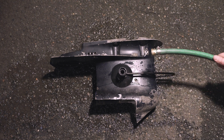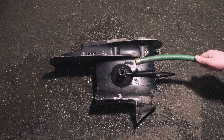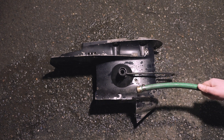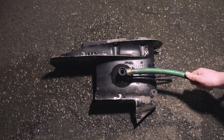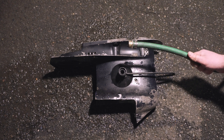What I've heard — I've not actually experienced this myself — but if you turn on the hose with too much pressure, what can happen is the water can push around and make it difficult for the engine to actually suck up the water because it's not freely flowing. So just be aware that the engine will do the job of sucking up the water. It has a water pump. Don't try to add additional pressure to force water into your motor. If it's not getting into the engine, something's wrong.